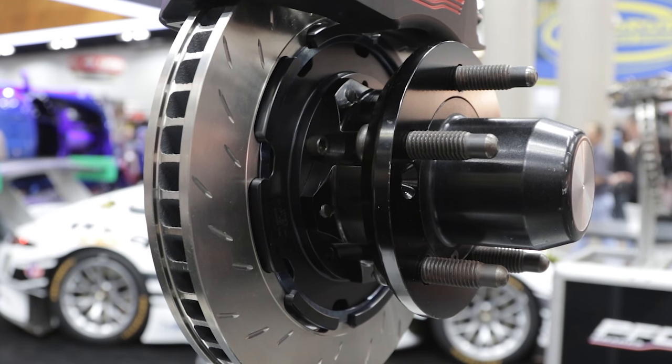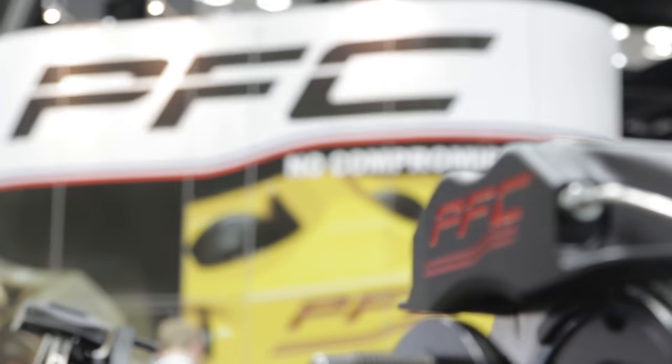How is the weight on this compared to a competing design? It's actually a half a pound to a pound lighter than most of our competitors' calipers. So reduced weight, reduced unsprung weight, allows you to move that lead wherever you want to on the car.